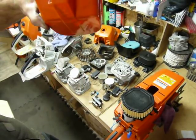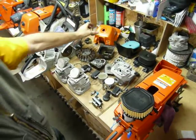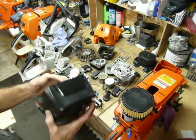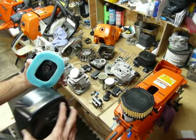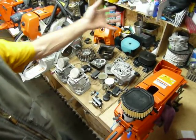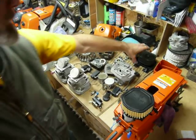Total Husky-style air cleaner cover, full of nuts and bolts. We're not going to monkey with that too much — this is the stock version. They do make an aftermarket version called the Max Flow. I always call these the whole-shot oiled foam element, which is really sweet. A standard cage comes inside those — you have to watch that you don't get a perforation, or you'll suck a lot of crap through there.